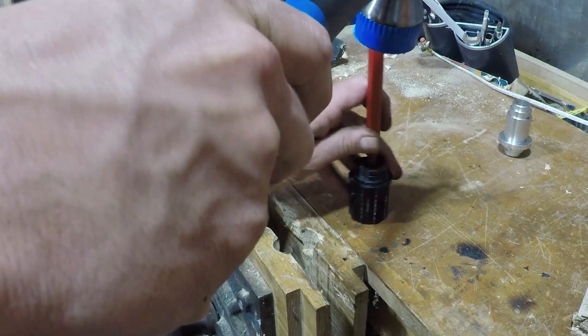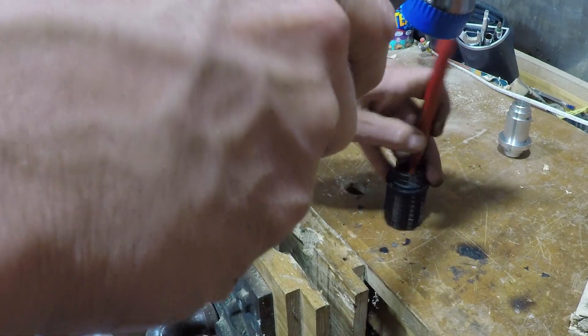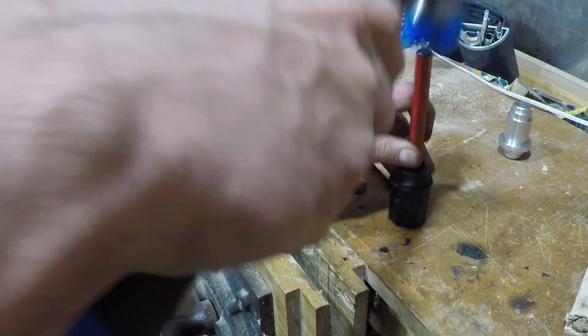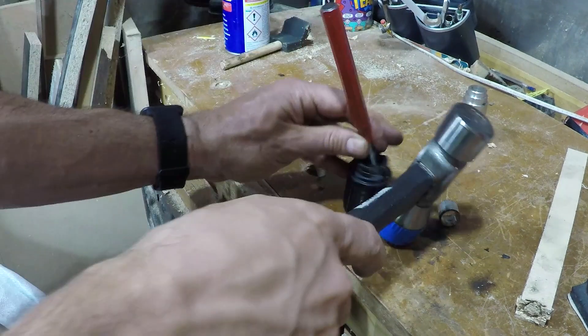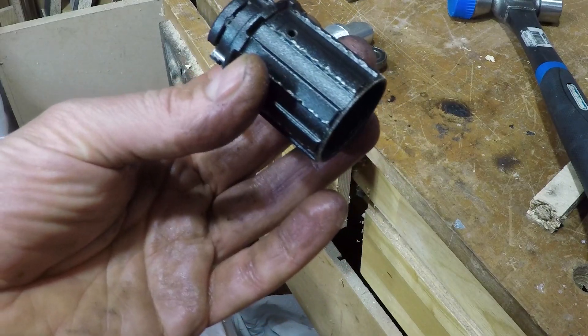Push the middle spacer to one side so you can punch out the outside bearing first. Move around the edge of the bearings in a race with a punch, tapping firmly and evenly with a hammer. The bearing and spacer will fall out. Now tap out the inside bearing — you'll need to tap it past the outside bearing's position too. Try and keep the bearing square to the edge of the free hub body. You'll now have a completely empty free hub body.